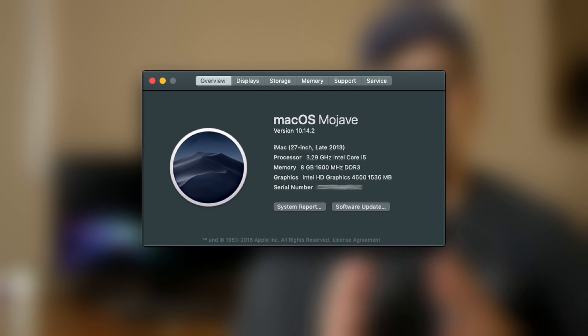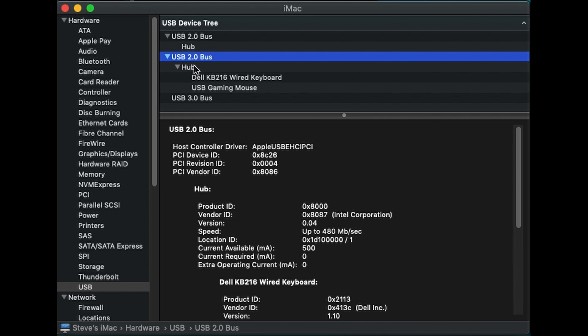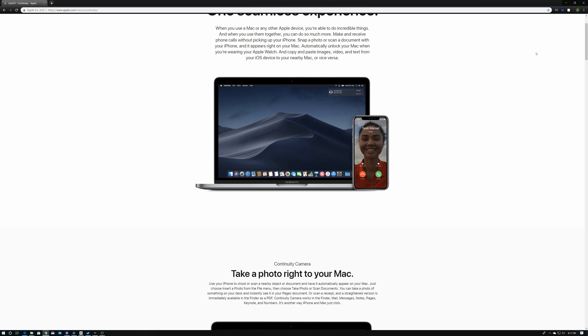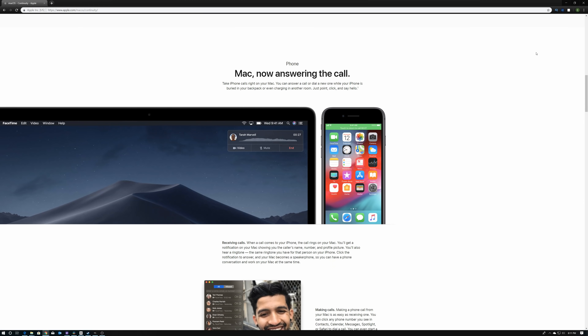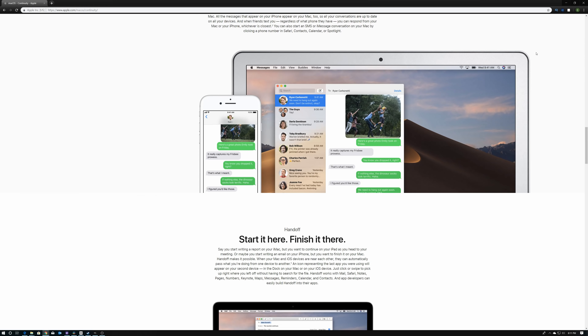If you have any other ideas for upgrading this machine, feel free to leave those down in the comments. The version of macOS installed is the latest as of today — Mojave 10.14.2 — and just about everything works great on this build. There are some exceptions: waking from sleep doesn't work reliably — sometimes it wakes but is extremely sluggish, sometimes it doesn't wake at all, so I'd recommend turning off the sleep feature. The USB 3 ports also don't run at USB 3 speed — that's something I'm still working on. And items related to continuity, such as handoff, won't work because those rely on a Mac-approved Wi-Fi card. You can add one, but I kept it stock, so in my build that doesn't work. But other than that, everything works fantastic.